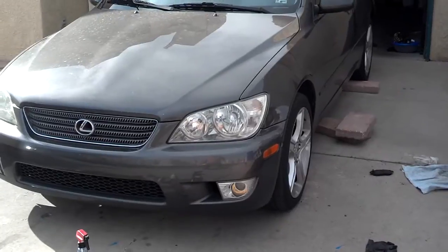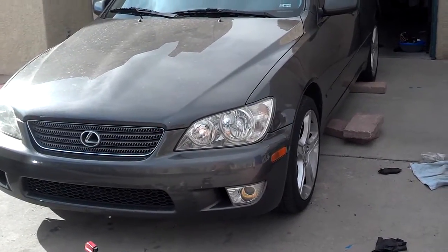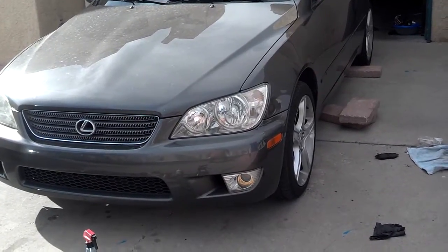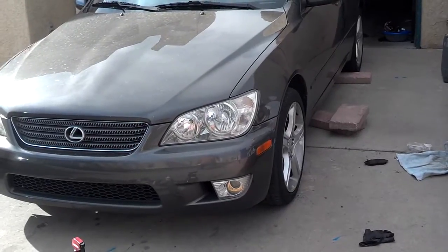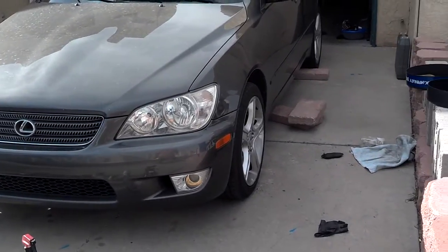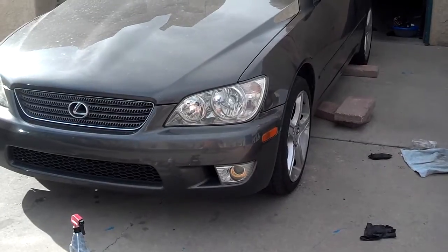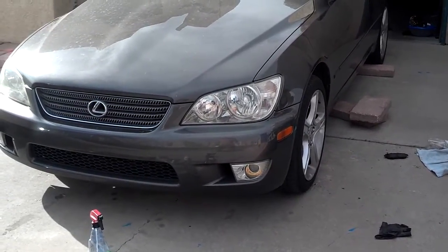What you want to do: block the wheels, set the parking brake, remove the wheels, take the calipers apart, take the caliper bracket off, knock the rotors off, and then go back in and check your suspension parts. Put your pads on, lubricate them on the contact point, put your anti-seize on there, and on the caliper mounting bolts I put a medium strength Loctite.